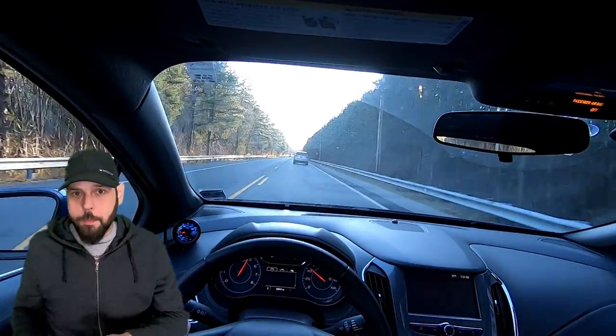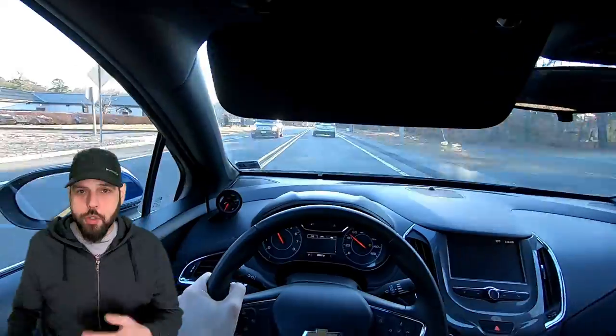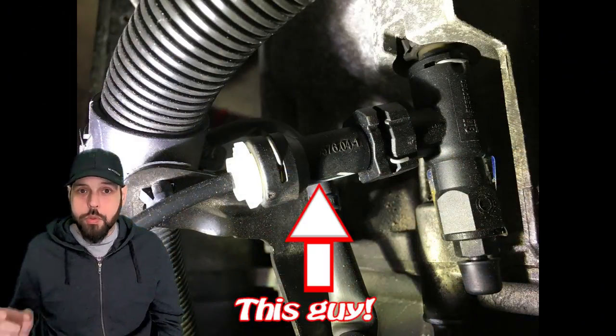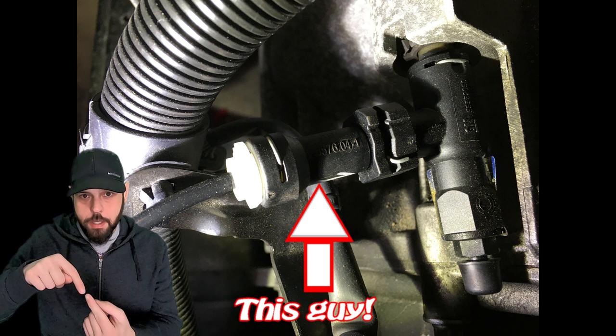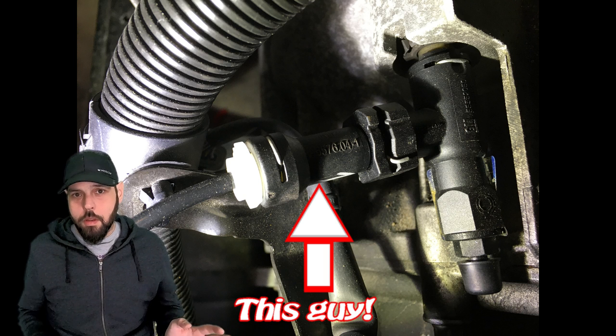The problem is now I can't put the clutch delay valve back in. That's one of the things I don't like about drilling it out, but it's really the only way you can do it. However, if you go get that part, then you can just swap out the elbow and have no clutch delay valve. You won't have any problems and if there's something you don't like about it you could always go back without destroying an original part. What I ended up doing was changing the whole accumulator and the elbow, but I didn't quite like how it was driving, so I ended up putting an actual generation 1 Cruze clutch delay valve in place. So I have the new elbow with the gen 1 clutch delay valve added to the system — and that for me was actually the best pedal feel out of everything.